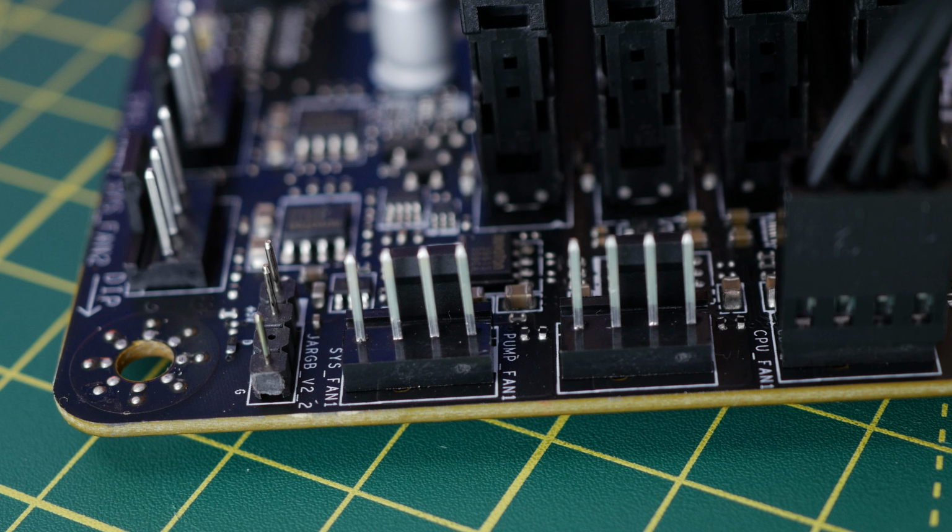You plug your fans in, just the RGB, not fan power, otherwise that makes it a bit more complicated. And then you plug in the USB cable from that controller to your motherboard. Now, obviously, this only powers 3 fans for the RGB lighting. So if you have multiples of these, you're going to need multiple USB headers on your motherboard or a controller, which is a separate consideration, and things get a little bit more complicated. So you can soon fill up these ports, especially if you've got multiple RGB fans in your case.